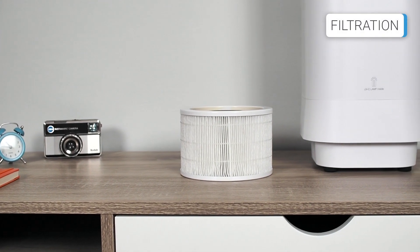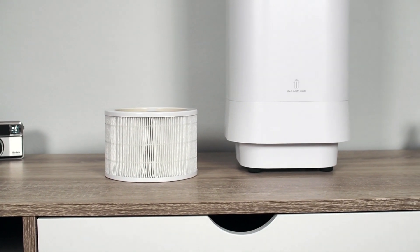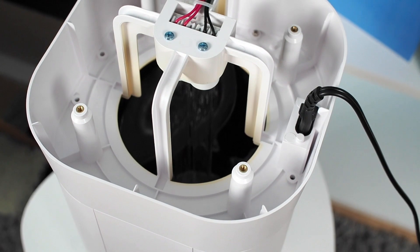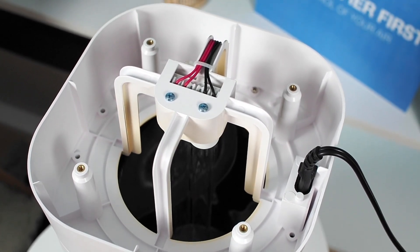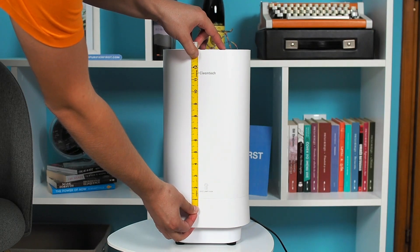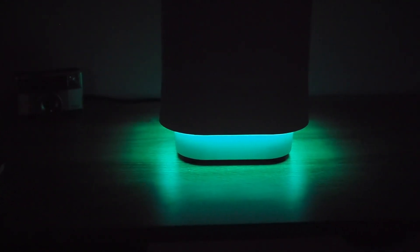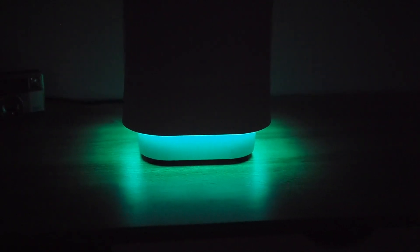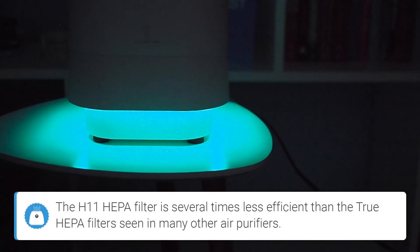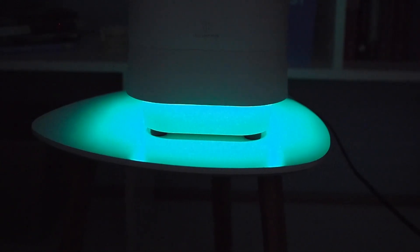The biggest asset that Cleantech emphasizes is definitely filtration. In addition to the HEPA filter H11, which is the first stage of filtration and serves as a pre-filter, Cleantech uses a 24-watt, 254-nanometer UVC germicidal lamp as the second stage of filtration. The UVC light occupies 75% of the device's surface area, which is much more than in competing air purifiers. UV is a technology used in healthcare, medicine, and similar fields where practical and fast bacteria killing is needed. The most significant difference between standard HEPA filters and UVC light is that HEPA filters trap particles, while UVC light kills bacteria, because UVC filtration is a slightly slower process.